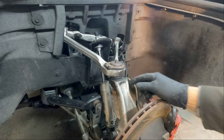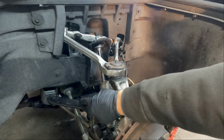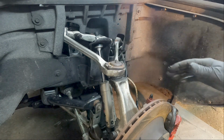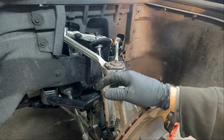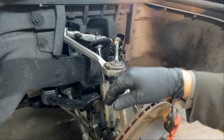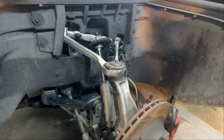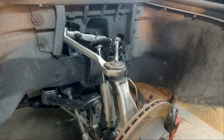But getting on to the spring pad, like I said, you have to disconnect the sway bar and the shock and get a load on it, jack it up. Like I said, as soon as you feel it start to lift the car off the jacks, stop, and then push the control arm down. You might have to physically push it down. And you can use any method you want to apply the grease. You can stick the end of the grease fitting underneath and just pump it.